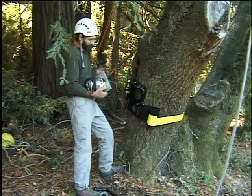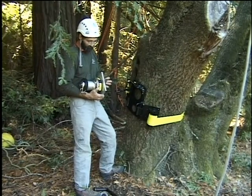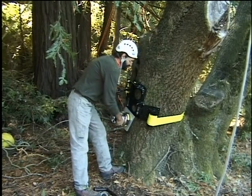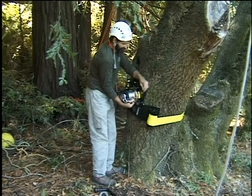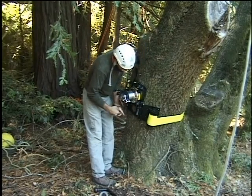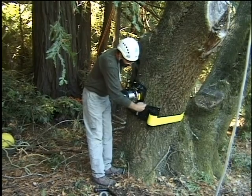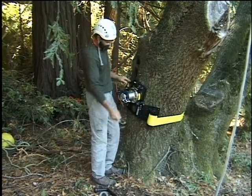The winch can only go in one way. The top of the plate is clearly marked with stamped lettering on top. You slide the winch in from the bottom, pull it up all the way until it dead ends into the frame member on top. Then this half-inch pin slides in down below and all it does is hold the winch into the mount. All the load bearing is taken up by the solid welded frame.